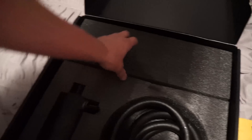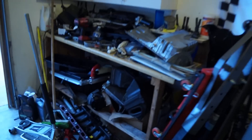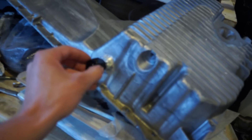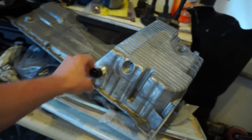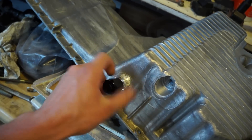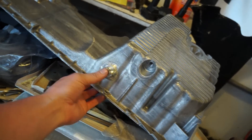Look at that sexy catch can — I have a couple ideas how that's gonna go together. We also got the oil pan fitted for an oil return, that's an AN10 fitting right there. It was welded a little bit lower on the pan than I would have liked, but I'm gonna be running a scavenge pump on the initial turbo setup, so I'm not too worried. A scavenge pump — for you guys who don't know — is basically like another oil pump after the turbo.